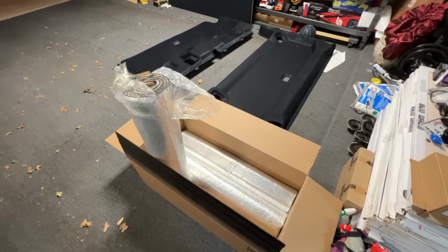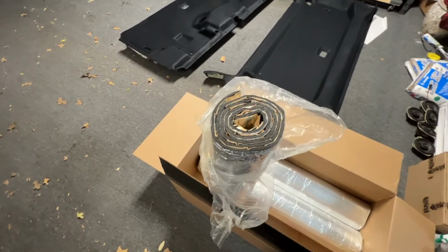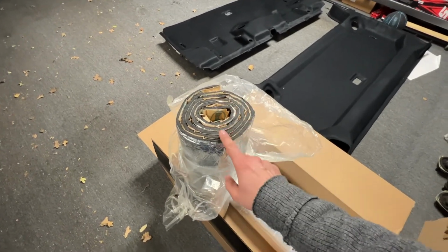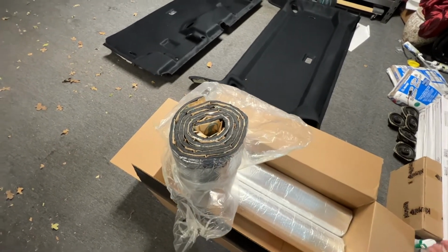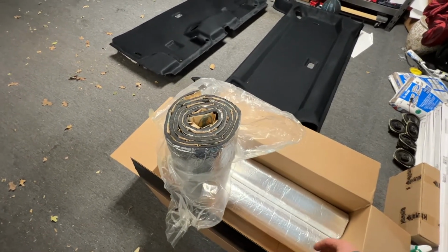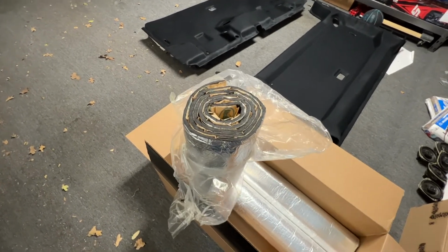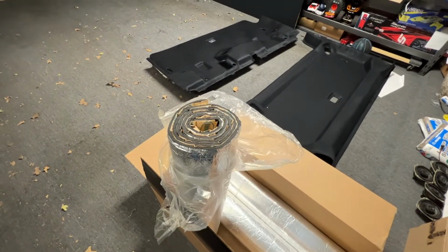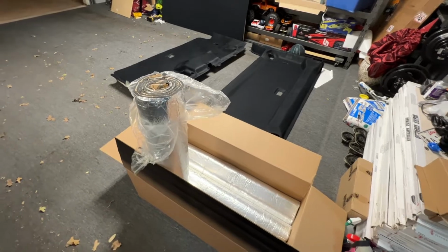This is sound deadening. On the doors, I've got 80 mil Kill Mat. That's going on the roof. I think, based on research, that this stuff should work better on the roof. And on the floors, I'm still gonna do some more research and figure out what's gonna work better. But 394 mil closed cell foam, I'll put the link down in the description if you want to order your own. That's what's going on the roof.